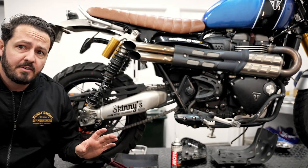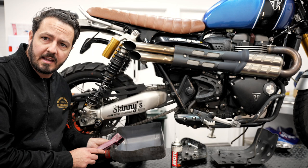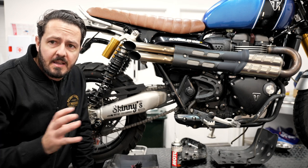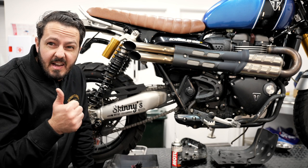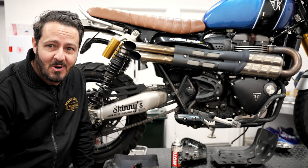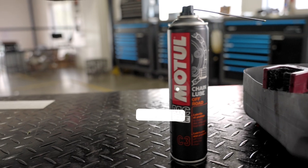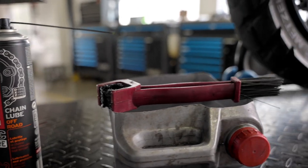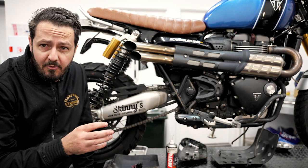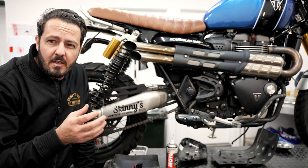The things you'll need for this video are some sort of brush you can use to clean your chain, just a little ice cream container with some fluid in it. The stuff I use to clean my chain is actually kerosene, but you can also use stale fuel or just fuel if you want. Then the next thing is some sort of chain lube — I'll explain further later when I go through lubing the chain. The lube differs between on-road and off-road because off-road uses an oil base, and on-road chain lube is more of a silicon base.